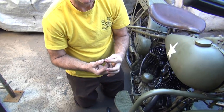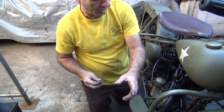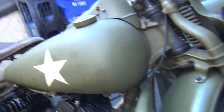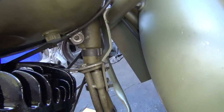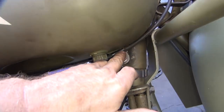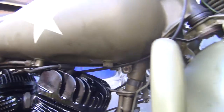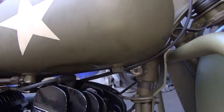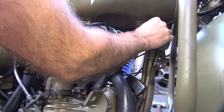You wanted. Okay. I got blue right here. Okay. I'm good. Let me see that. Get the light on. Light's on. Camera's on. Okay, we bent the clamp up at about a 45 degree angle out to clear the tank. I took the washers off, so we're going to run a nut. I put Loctite on it to get maximum holding power.